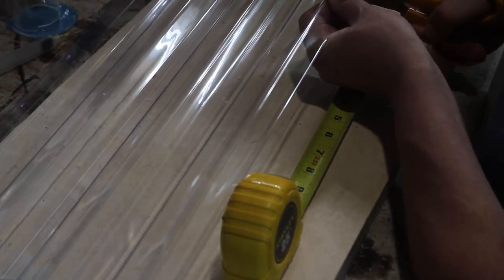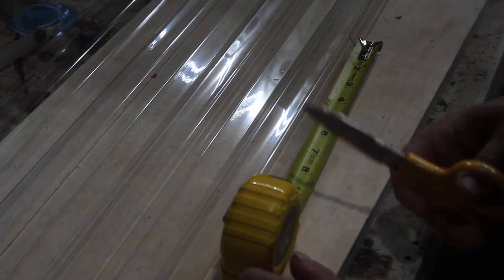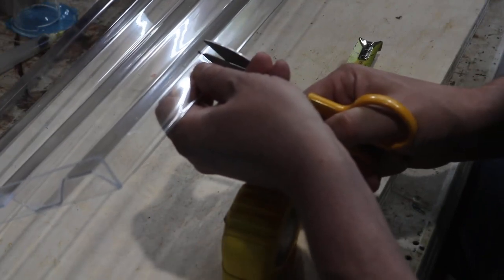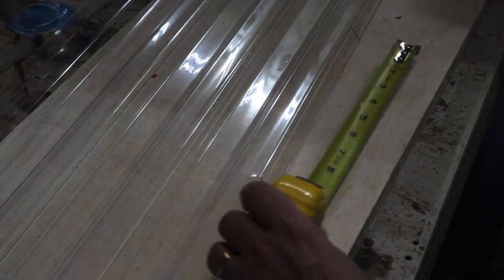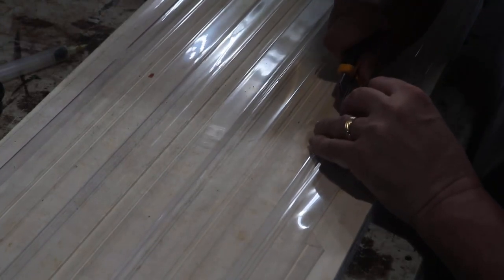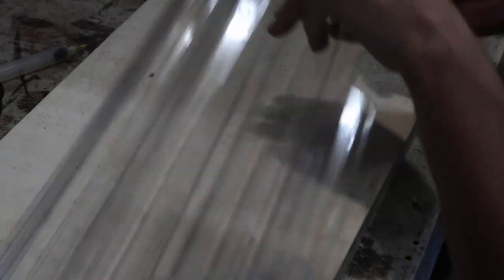So this is the second one — they're roughly about the same size. What I'm going to do now, very easily — this is probably the best selling factor for using polycarbonate sheets like this — it is extremely easy to work with, you don't need any tools. This is just a good quality pair of scissors, and it's just a simple matter of snipping it off. I did it in two steps. This direction is really quite easy to cut with scissors, but instead of trying to fiddle around and get the scissors to go around the corner, I just flipped it over and scored it with the utility knife. I also need to cut out a little extra bit for where the intake is for the filter — that's what this little notch here is for. You only have to score it once to break this stuff.